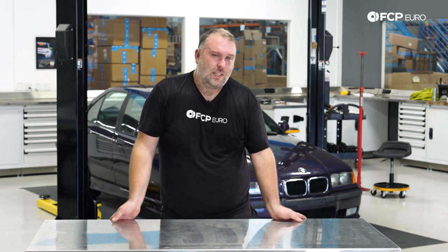Once everything settles over those first couple of weeks and you get the proper alignment done, you won't really have to make changes again. If you want to do a corner balance, that takes more expertise — you'd need scales and likely a shop. As you can see, coilover installation on the E36 is really not that difficult a job. This information applies to installing normal struts, shocks, and springs as well. We found a lot of other issues working on this specific car, but it's a project vehicle — those will be addressed over time. Hope you learned something — leave questions in the comments, hit the like and subscribe buttons, and we'll see you for the next one.